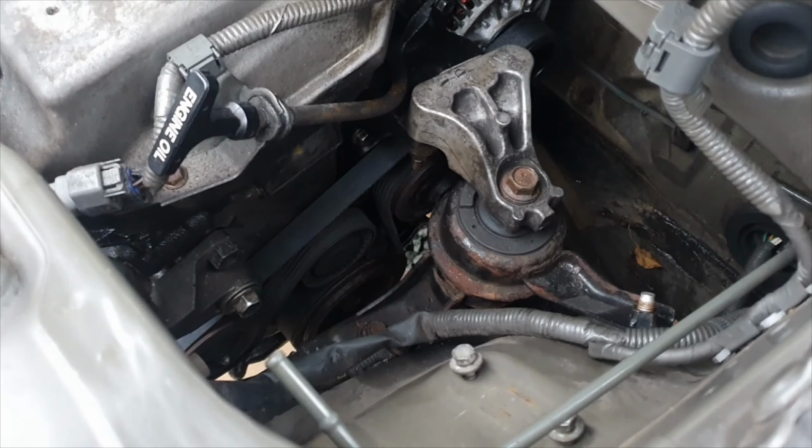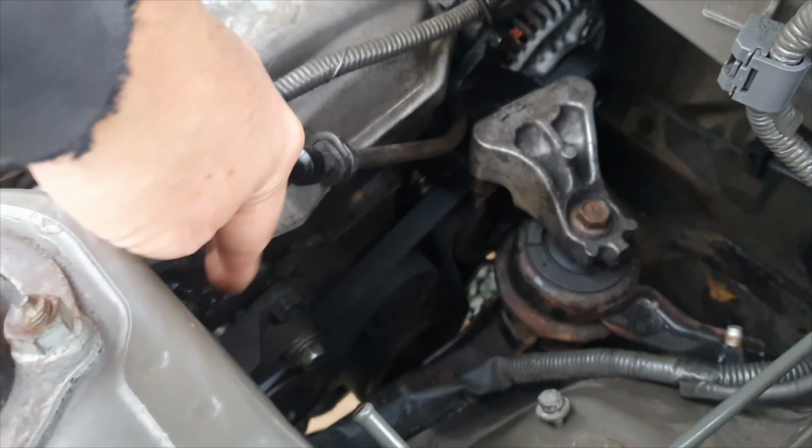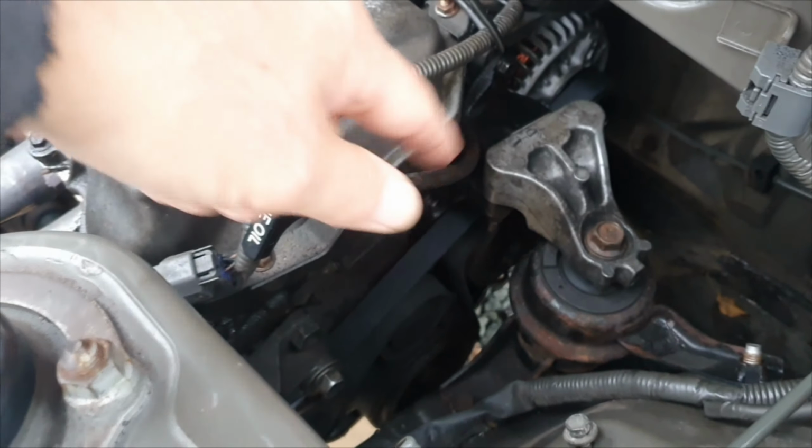Well, that's the new belt put on. Easiest way I found is feed it all the way through. Don't feed it over the alternator pulley though. Keep that one slack, and then when you get the socket on the adjuster down there, or the spring tension I should say, you push that forward, give it some gentle but progressive pressing, because there's obviously a damper unit in there, and at first it doesn't want to move, but just keep at it. It'll go all the way forwards with a breaker bar on it, and then you can just hook it over the front of the alternator pulley afterwards.